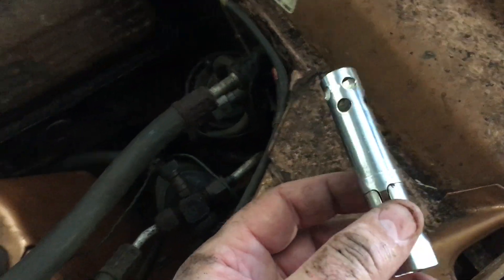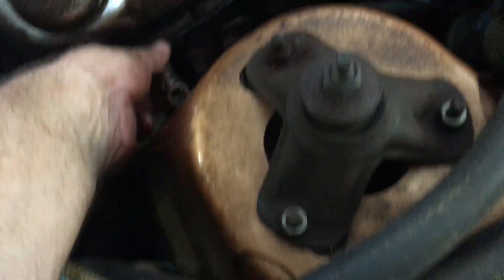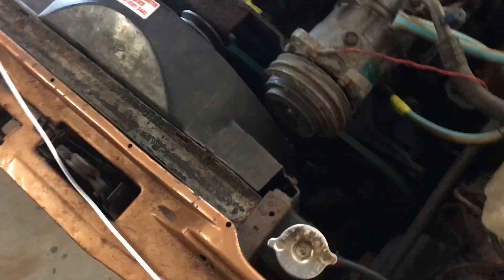I find on the Cleveland the easiest way to do these is just a simple tube spanner with a screwdriver poking through - there's just no room for decent stuff. These are easy to fit between the shock towers and everything. Very simple: screwdriver and whack them, undo them.